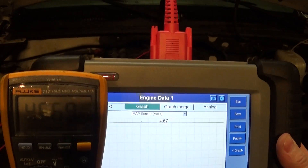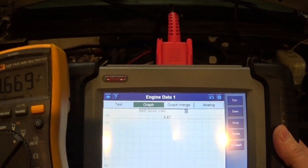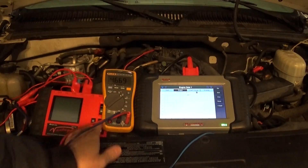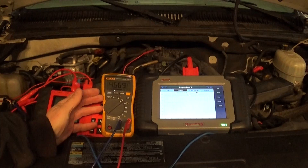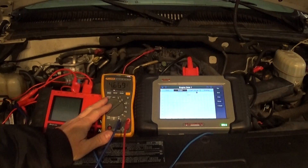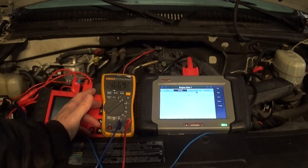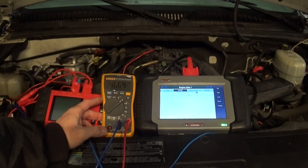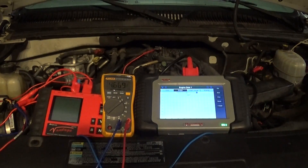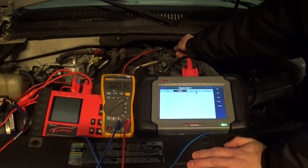So we have essentially the same voltage on our voltmeter as on our scan tool. After we connect this, if we read zero volts at our scan tool but 4.48 volts on our voltmeter, then we know we have an open. And if we have a short to ground, everything is just going to be pulled to ground and the voltage will go down to zero.